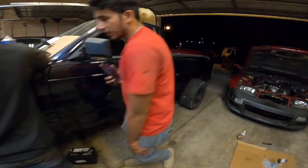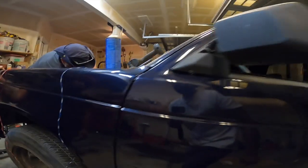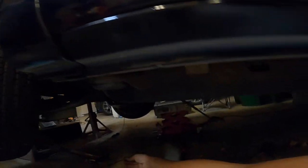But if you're gonna tie in the Holley system to the fuel system, Holley runs this green wire and it runs into this tan, but we used a jumper to make sure, because online I had dark green as the fuel line.